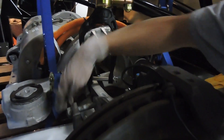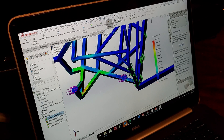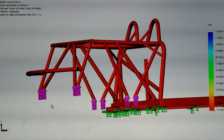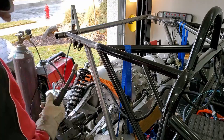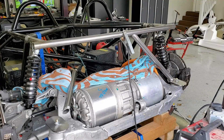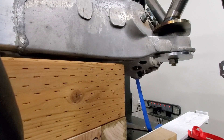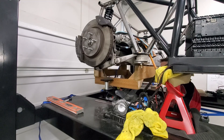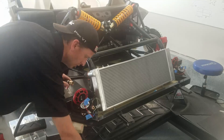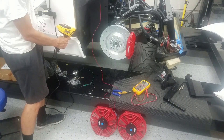Then I looked at how best to fit the Tesla subframe onto the existing K1 Attack frame. Went through a couple of iterations and did a few analyses. From there I started chopping up the frame and welding on the new structure I had designed. A very big milestone — we got the motor mounted to the car, took away the support, cleaned up the frame, painted it, and then moved on to cooling for the motor. Got the fans and thermostat all working just right.